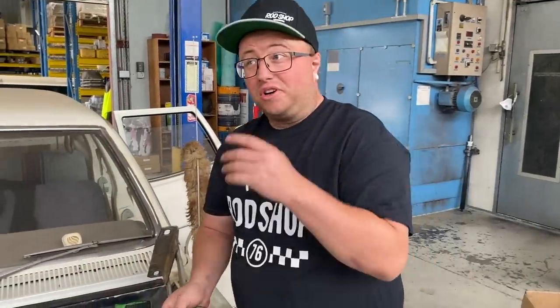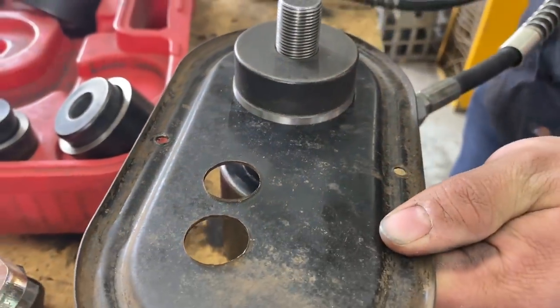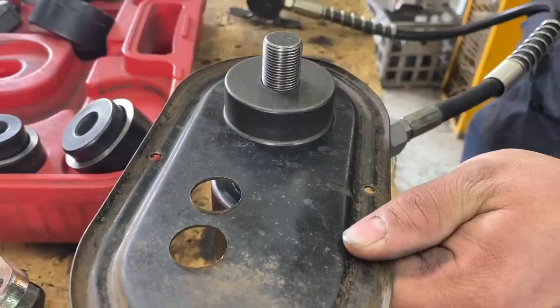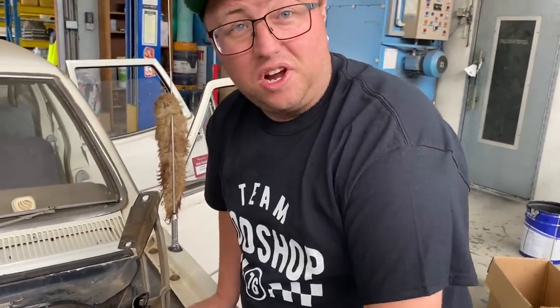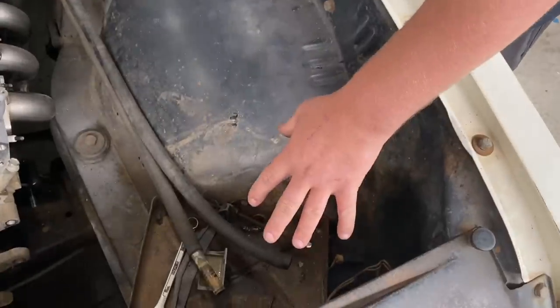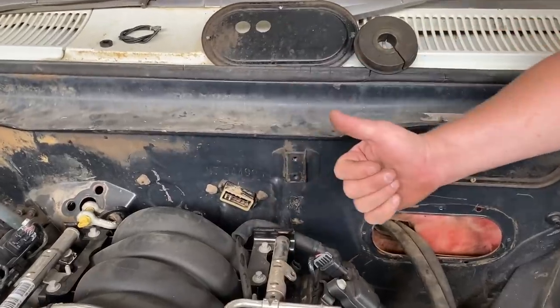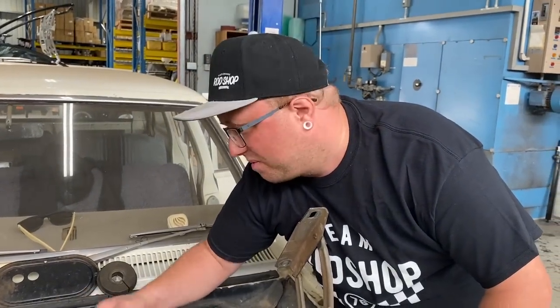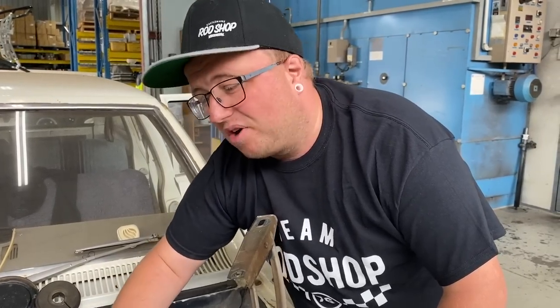Now that I've removed the panel, I'm going to send it down to the boys to drill a 60mm hole so we can fit the factory wiring loom. I've removed the external regulator, no longer needed with the LS engine. I've removed the battery cables. Now moving on to the old engine plug — it's got the main battery positive that fed the original fuse box, the ignition wires that went to the original coil, and we're going to do an ignition bypass. With these old cars they used to run a points ignition, which isn't strong enough to power the ECU. We'll need to change that to a 12 volt system, which I'll show later.